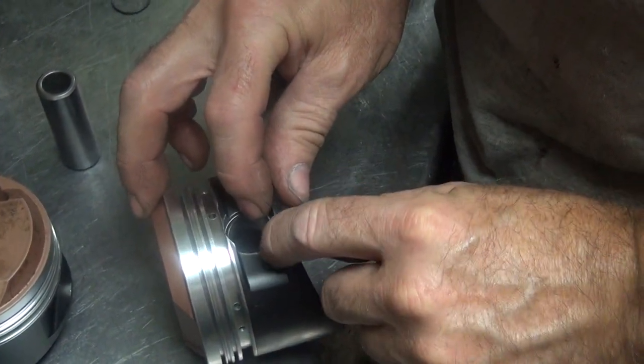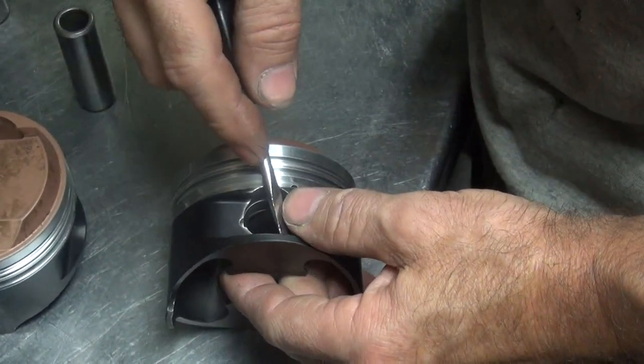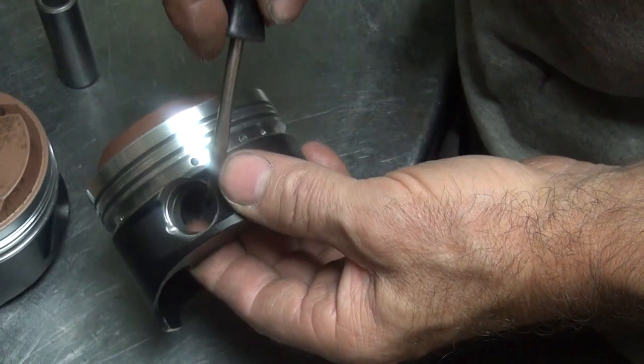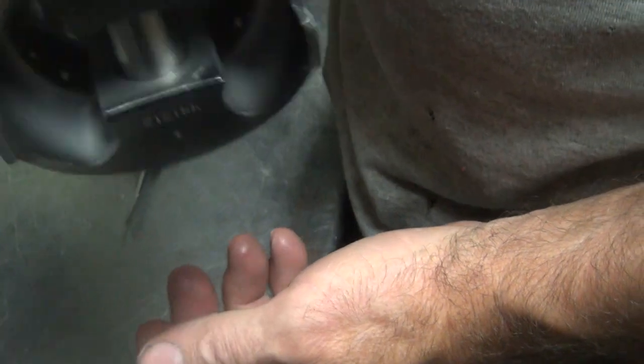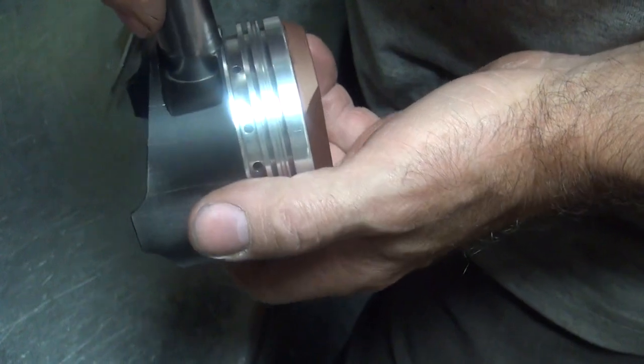See how you're pushing in, and see the hole's right there — got it over the clip. Then you make sure you push this down into the clip equally. See, that's in the clip. Sometimes you just take this and go like this over here, and you can jam it out. Did you hear it? Now it's solid. That way you don't scratch up your piston like I did with my screwdriver. That's how you know it's in there good — because it doesn't sound like that if it's not hitting evenly. You can tell a lot of things by noise.